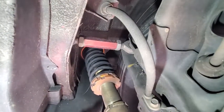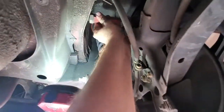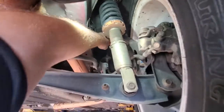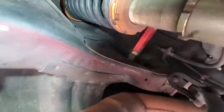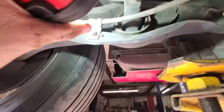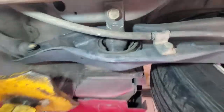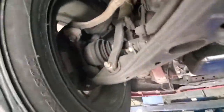In the back you've got what I just call control arms. One side looks pretty worn out — I'm probably gonna have to replace it. That side over there is suspect; it looks like it's breaking apart. That side looks okay. I know I need some wheel bearings, and that trailing arm bushing looks pretty nasty too. But anyway, normal maintenance on a 20-year-old car.